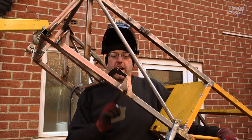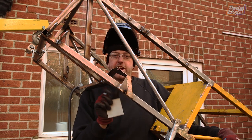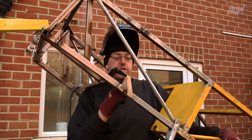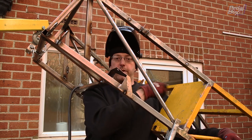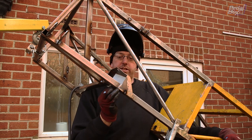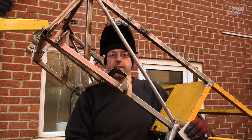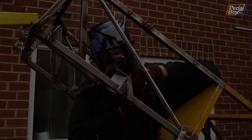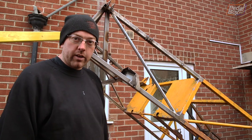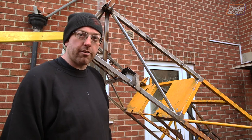One thing we haven't done until now is closed in the back of this mount. We don't want to close it in fully because it will create a pocket under here that gets full of rubbish, but we do want it closed in so that anything kicked up this way doesn't come further in and fill up the back of the car. So we've got these two little plates that we're going to weld in, one this side and one the other side, that will just close it off so anything that comes in will drop down into the bottom of the car. The last thing we're going to do before we put the body back down again, while it's up in the air, is take these firewall panels out because it's a little bit easier to get into some of these rivets.